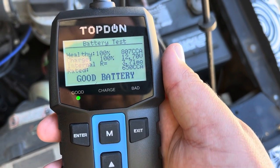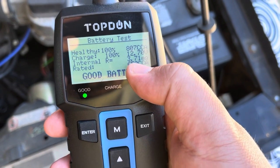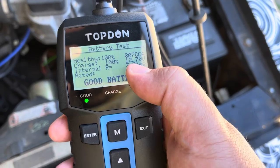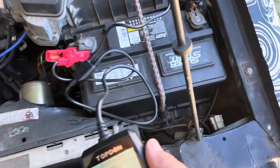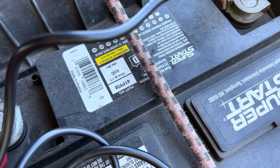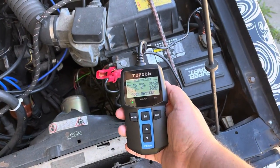This did 807 CCA — it's only rated at 650. Very low internal resistance and still sitting at 12.7 volts. It's amazing. This battery did better than rated — 650 at zero degrees Fahrenheit. Does better than rated.